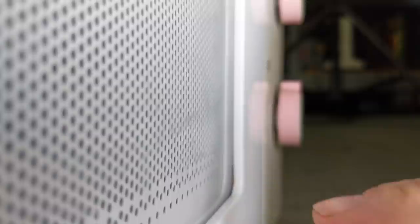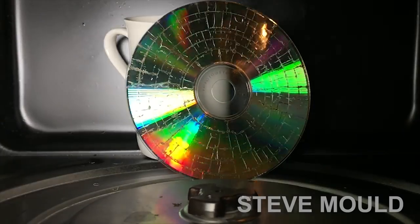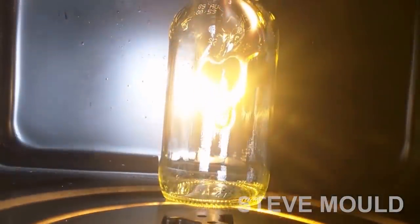I actually skipped a step, which is the removal of the layer of glass on the outside and the inside — glass produces glare. Something else interesting I learned is that although the mesh stops microwaves propagating out of the microwave oven, they actually attenuate over a short distance. Right next to the mesh there is some microwave radiation, but it drops off exponentially. That's why you have that layer of glass on the outside — it creates a gap between you and the mesh. As a note of caution, don't put any of your body parts up against the mesh, and especially don't put your eyeball up against the hole — it can cause cataracts. Anyway, that's how I was able to film expanding soap, sparkling CDs, and melting glass.